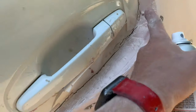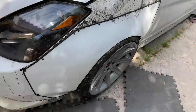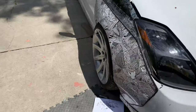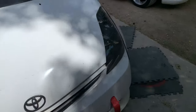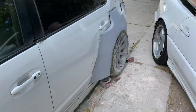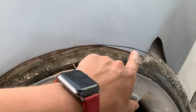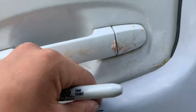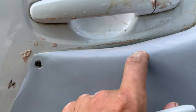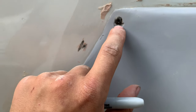I'm going to hit the edges and where the gas tank is. These are already painted — you can kind of see the design I'm going for, at least for the front ones. The backs are done. The only one left would be this one back here, which I left unpainted to show you the process. All that's left is to trim it just a little bit right there, fix that crack — that's just very thin fiberglass I kind of sanded through — so we're going to patch that from the other side, Bondo it again, sand it down, and fix this little hole right here as well.